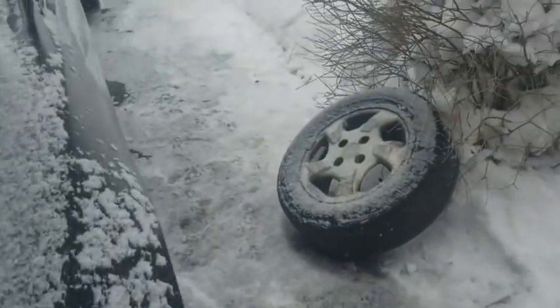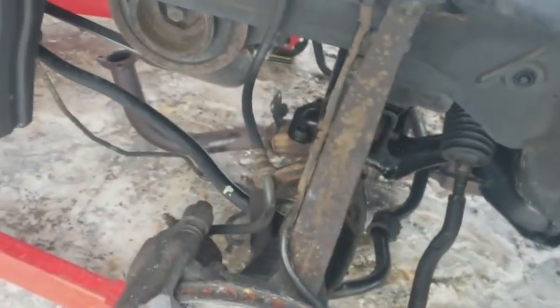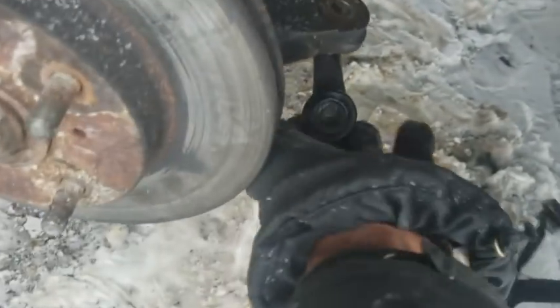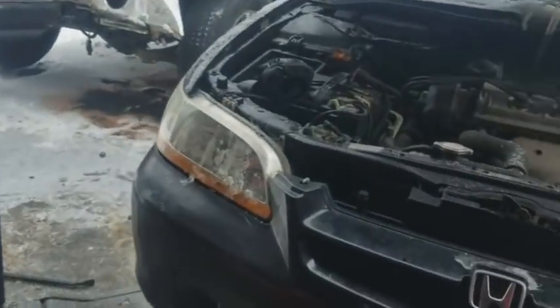At the same time, mind you, the steering rack was in there also, so I had to be constantly going inside the vehicle, making sure that the steering rack was actually going to line up with the steering and that the steering wheel is straight. Make sure I don't have it spun 360 degrees the wrong way. So the tie rods, it's all done properly, so the wheels are straight and the steering wheel is straight, so I know I have it aligned properly.